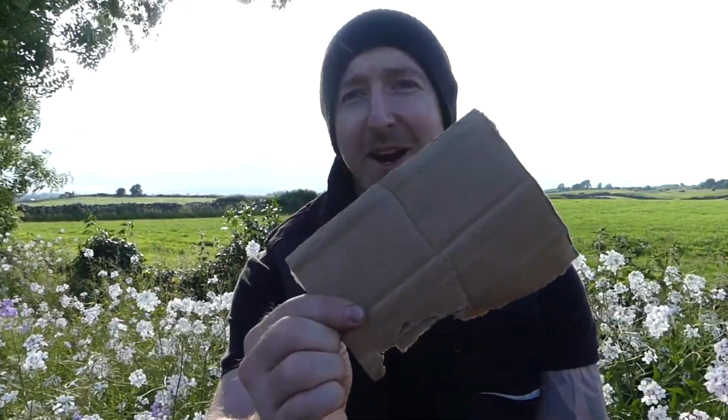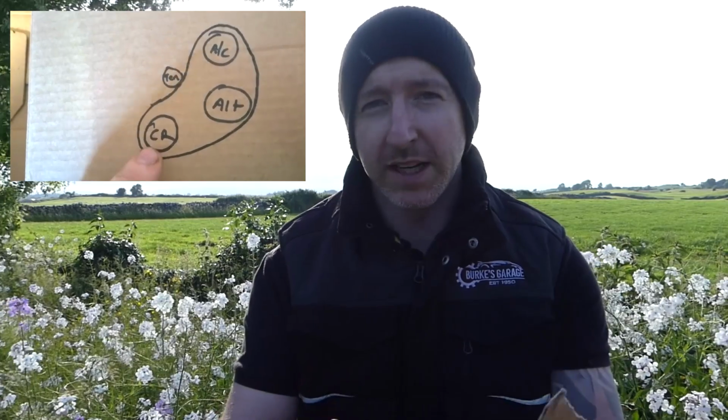Okay, so the first item I'm going to speak about is cardboard. It comes with the timing belt kit. Every timing belt kit that you get, you're going to have it as part of the box. I'm going to insert clips as I go along in this video and show the purposes in real life terms on how I apply them, but I use cardboard for drawing the auxiliary drive, especially if it's a complicated one, so I won't mess up wasting time trying to find out the routing or have to dig out my laptop to get auto data and find out which way the drive belt goes, etc. So that's one use I have for it.